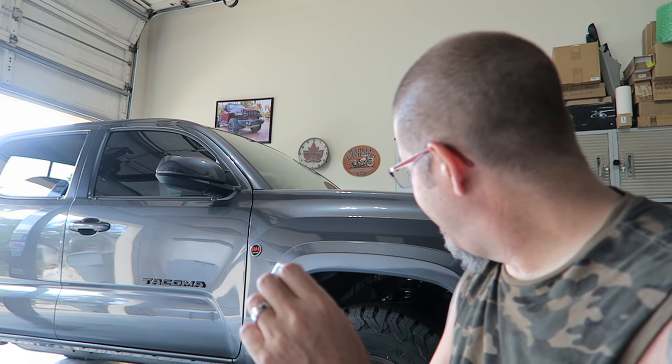Obviously the body of the truck would be higher if I did the lift, but I'd still have the same result from the tires. If I did a 2-1 lift, I would actually end up with 3 inches in the front and 2 inches in the back, which would probably cut into the rake that the front of the truck still has. When I measured it the other day, I still do have a little bit of a lean in the front — a little rake — but with the naked eye it's not really that obvious. The amount of rake varies per Tacoma depending on suspension settlement.